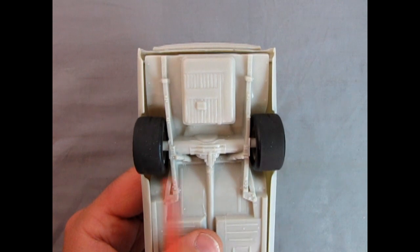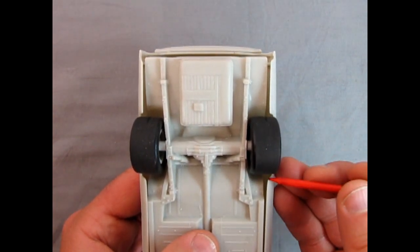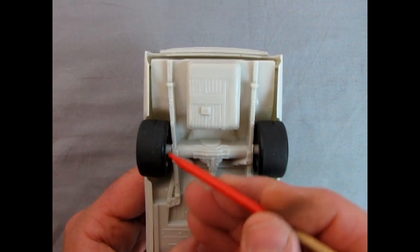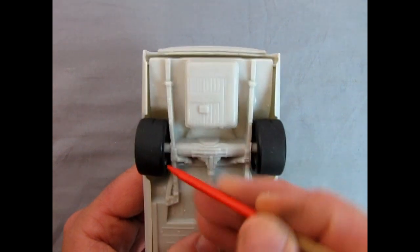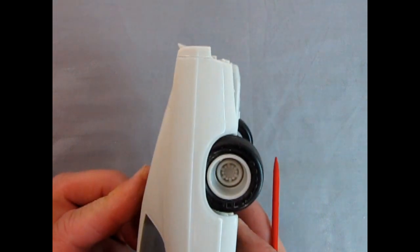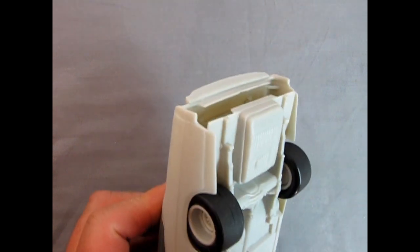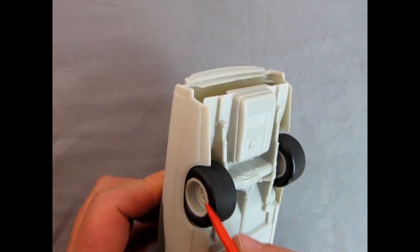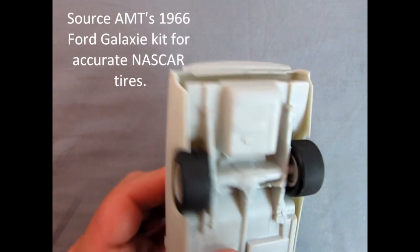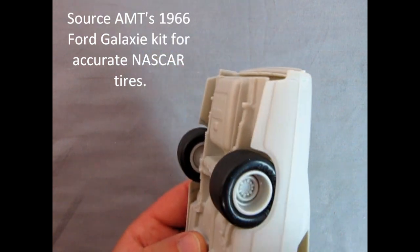I cut a slightly larger axle to fit in these slicks, and it's actually a bit of a shame — these slicks are so wide, wider than what really would have been at NASCAR. If they were a little narrower we wouldn't have to cut the rear wheel arches open because these fit in really well. It's just that they're fat right in here from this part of the tire bulging out and hitting against the inside of the rear fender — if they were just a little bit narrower we would be fine without radiusing the wheel.